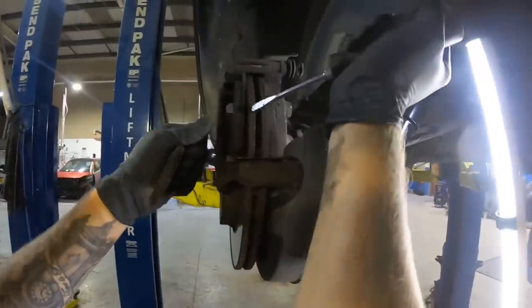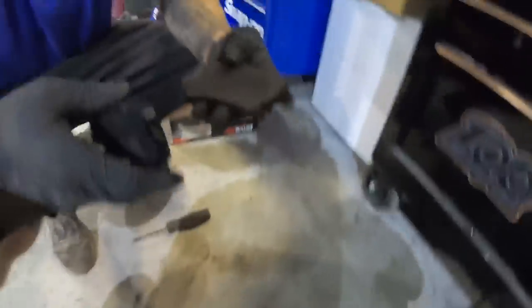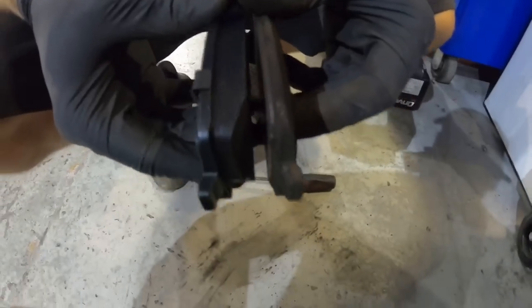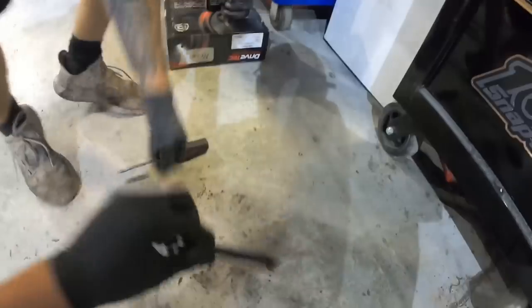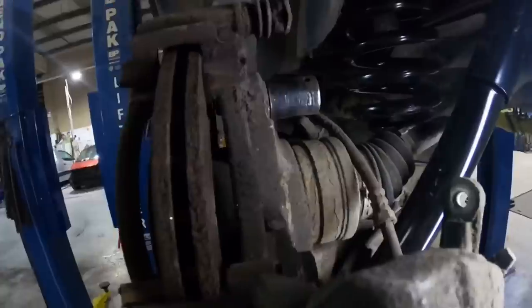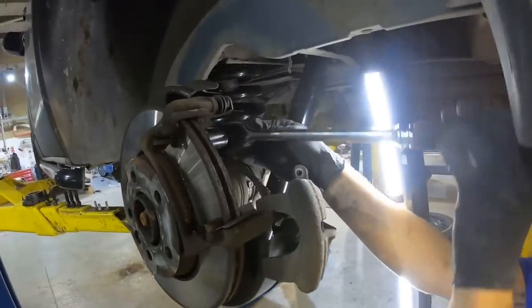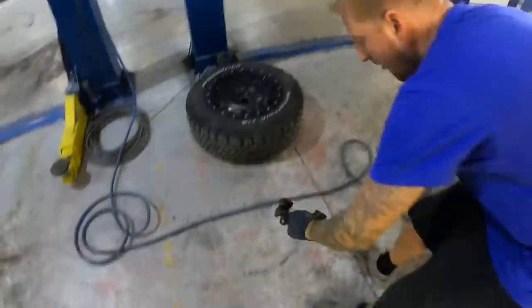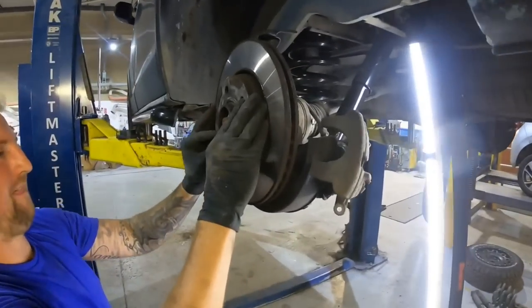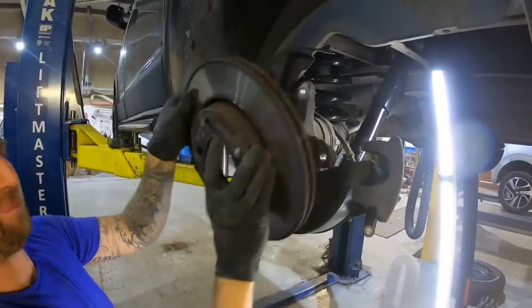Right, look at your pad - she's gone isn't she. So what we do now is compare. That's your inner one, that's your new one going on - they haven't been changed at all have they, they're probably originals. That's thinner than the new one. We need the 21 mil socket on the back with the big bar - there are two bolts that hold the carrier on. There we go, that's the carrier - leave that in a safe place. Take the grub screw back off, put it back on just to hold the disc, then the disc comes off.